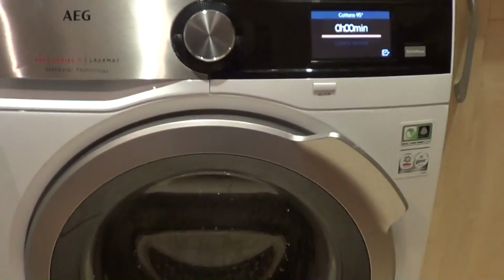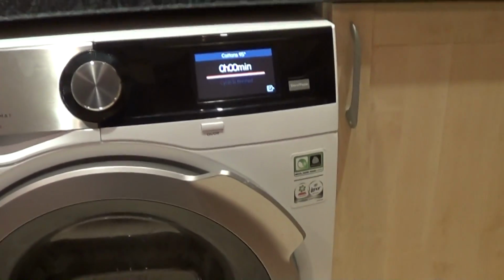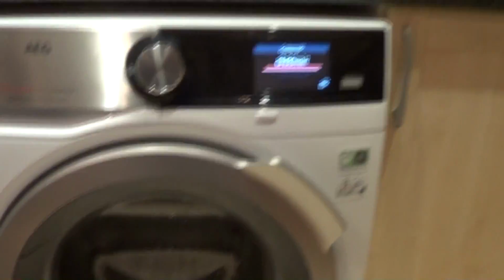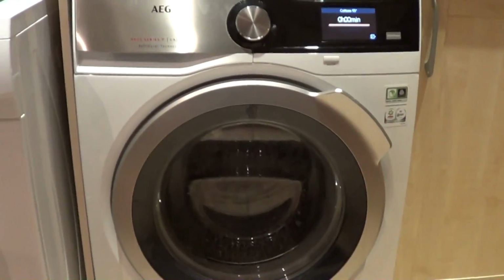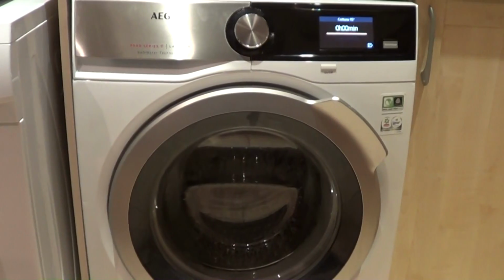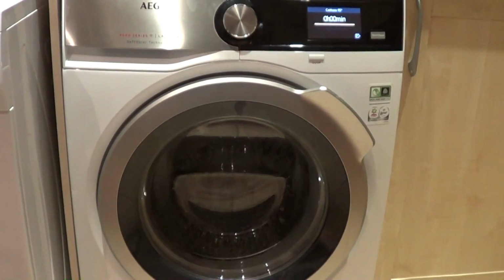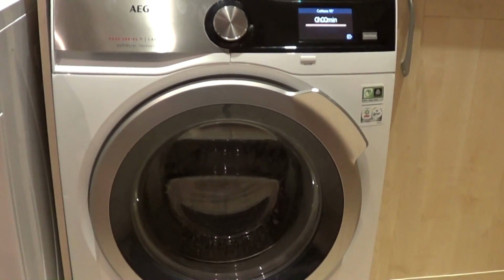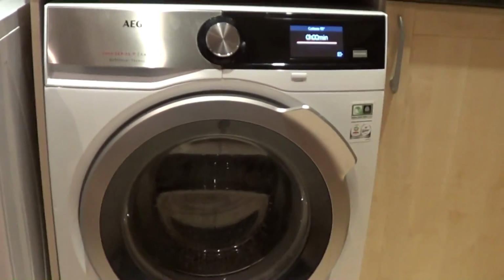Basically, I'm not sure whether the heater relay is sticking every now and then. So what happened was, genuinely, the guy I bought it from had it in, had it working, and put it up for sale. Then they put it on machine clean as I was on the way to get it, and while it was on machine clean, it just tripped to earth. The heater that was in it had totally gone to earth, completely.